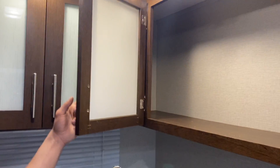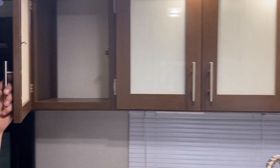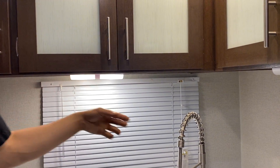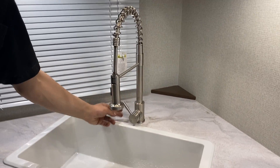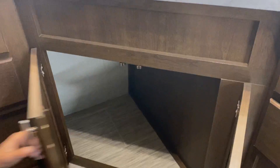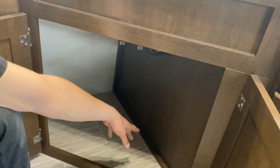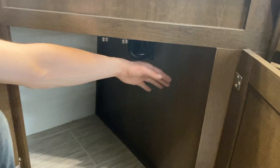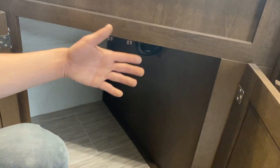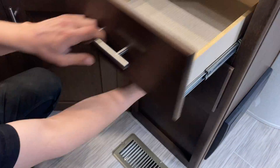Power outlet on the wall here, storage all across the top. Right underneath, there's a light here and up here. It's a sink with hot and cold water, of course, with storage underneath it — just be mindful of the drains up here when using that storage. If you're looking to winterize the unit yourself, there are three screws for this panel — pull that back and your water pump and hot water tank are right behind there. A little bit of drawer space on either side.